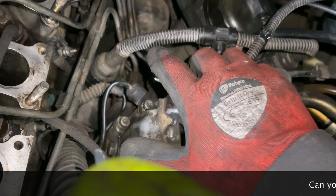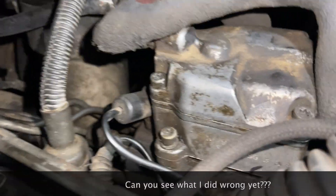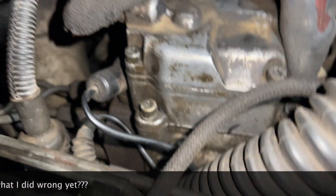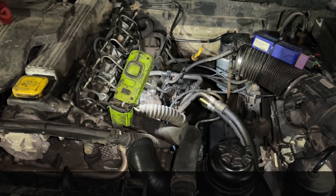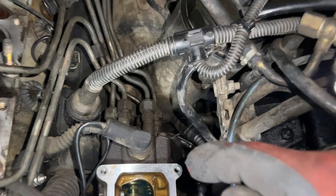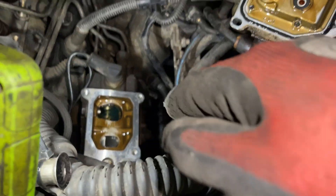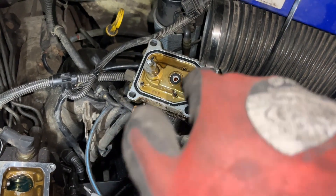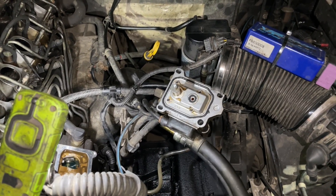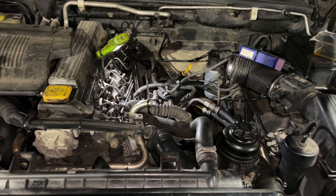I've loosened them and yes, you can see it moves quite a bit, so we need to get our score line lined up as best we can. Inside the pump there's a little knob sticking out that has to go back into the hole in the cam, so you've got to be really careful when putting it back together. I've cleaned that face off with the blade and some brake cleaner and done the same with the mating face before changing the gasket. New gasket is on, faces all cleaned up on both ends — time to put it back together.